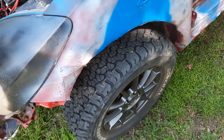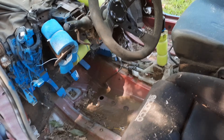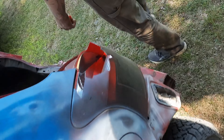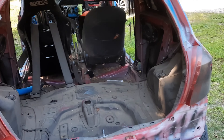The internals are good — motor's mint. She's got diesel oil, she can go. As you can see, this thing moves right along. Color matched pedals, very nice. Color matched airbag ECU — fantastic. OBD2 sensor, color matched — yes, it still works. We just plugged the standard into it. No codes! Hell yeah, no codes. Three out of the seven readiness monitors are set, but so what — there's no codes. It's running on a base map, it's fine.